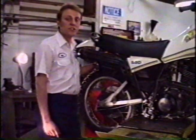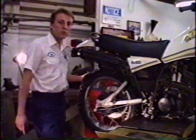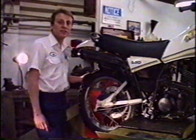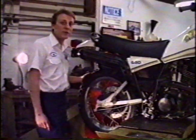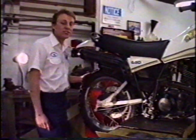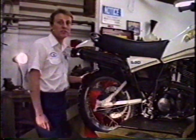With a Bridgestone M22, I recommend running about 12 pounds of air. I'm running a Bridgestone Trailwing, which came stock on this XT550. It works really well with 8 pounds of air. Again, depending on your weight, what you want to do with the bike, and your style, air pressure is going to vary, and it makes a tremendous difference on your wheelies.